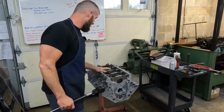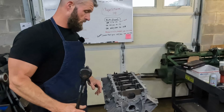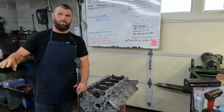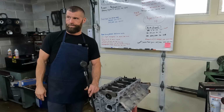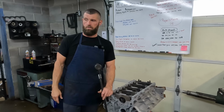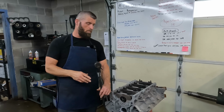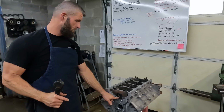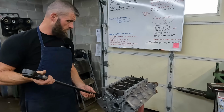All right, so main bearings are in it, they're torqued. And I measured all the mains on the crank, and they were all within a tenth or two. So I just averaged the diameter, and then I just set the bore mic. So hopefully we'll be all right. Sometimes these things are a little loose, but I hope we don't have that problem.